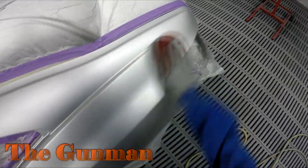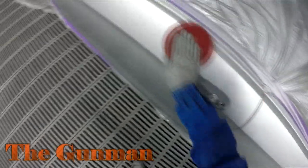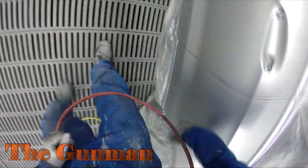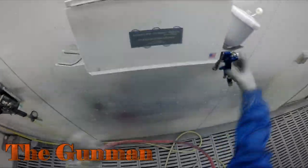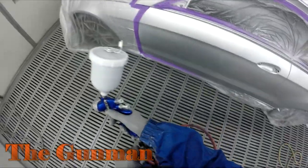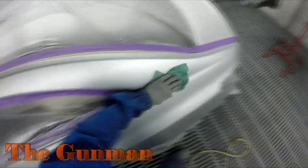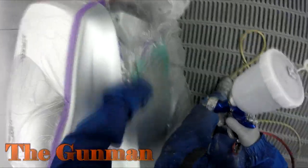I could see a little bit of an edge — literally just where the wet-on-wet primer faded out, it was just a touch on the rough side. That's where my booth box really comes in handy — I've got spray booth essentials in there: a couple of razor blades, fine-line masking tape, and 1000-grit sanding sponges. I'm giving the whole job another tack rag — it's cleaning off any overspray that's landed on the blend areas and any dust left from the scuff. Keep it clean, as they say.